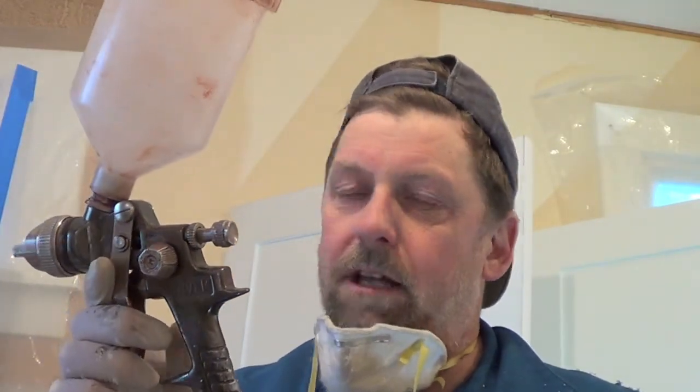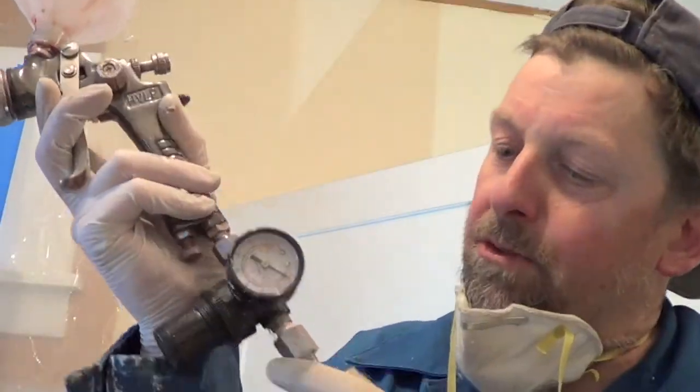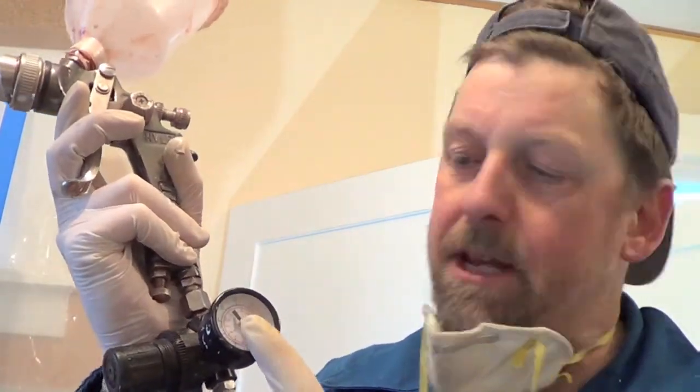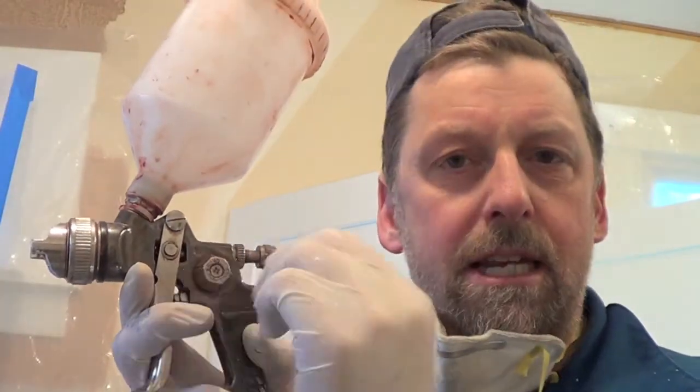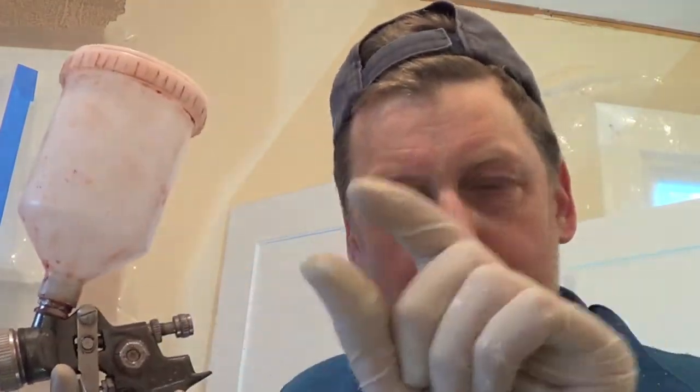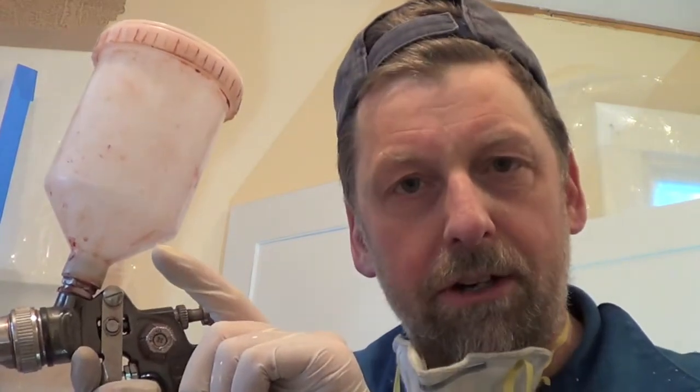Today I have this little gun available at a lot of automotive stores, paint stores, or hardware stores. It's HVLP — high volume, low pressure. It has numerous functions: you have your air control, your amount of pressure coming in — you keep that low, it runs at about 40 PSI and my compressor is cranked up to 120. Another control on the gun is the dimension of the fan, so you can narrow it right down for trim or make it wider for painting a door.